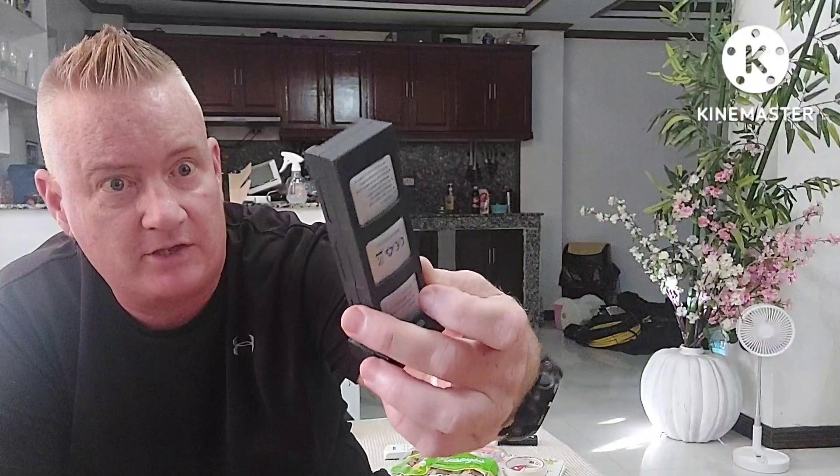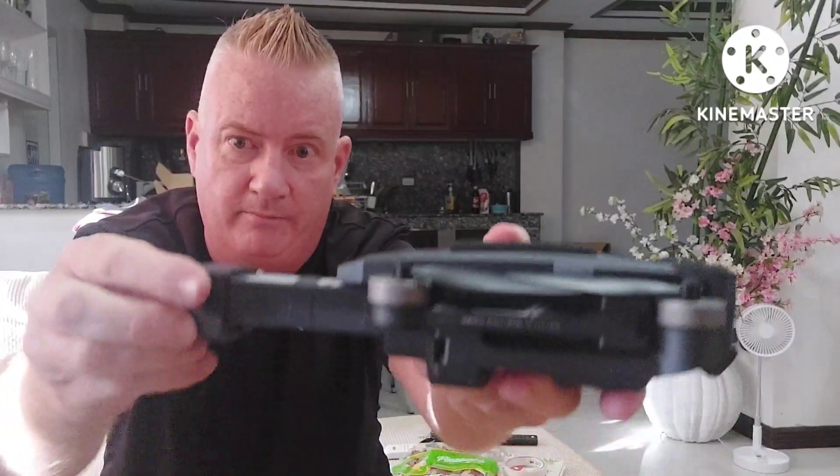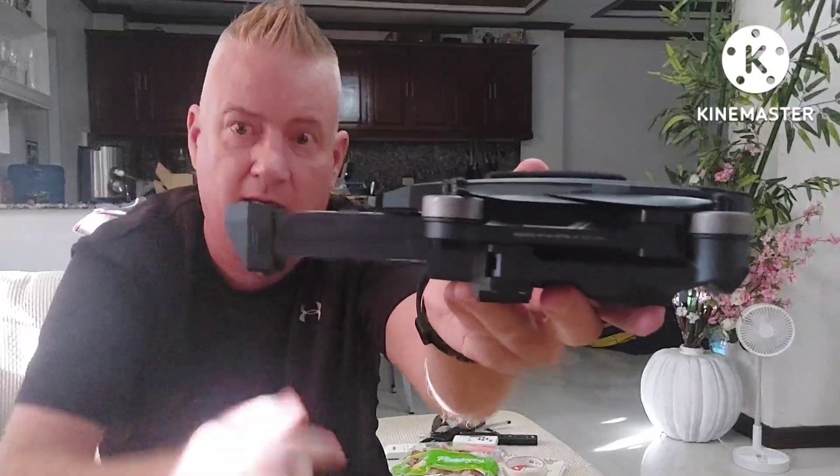Take a look at this. You see them a little bit puffy on the outside? This one's not so bad. I have to put the drone in the freezer in order to take the battery out. I put it in a Ziploc bag, put it in the freezer, and after about 25 to 30 minutes I'm able to get the battery out. But the first battery that started bloating - I put an X on it so I know not to put it in the drone. It can't even go in the drone. It used to be able to fit, but now I can't get it in anymore.